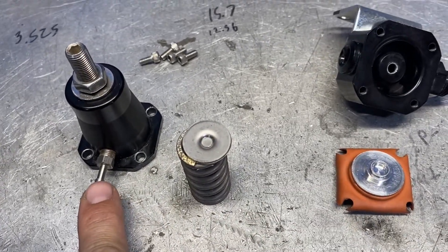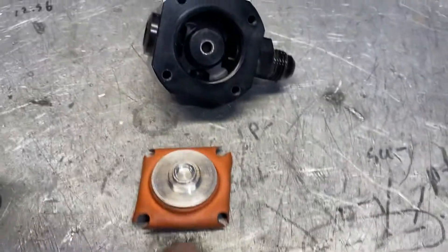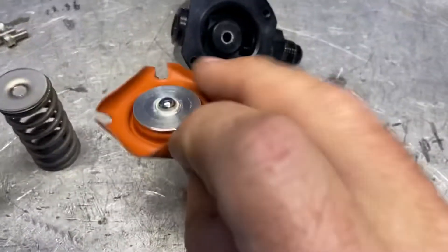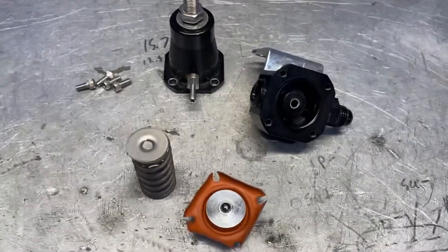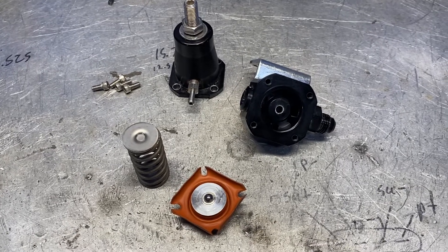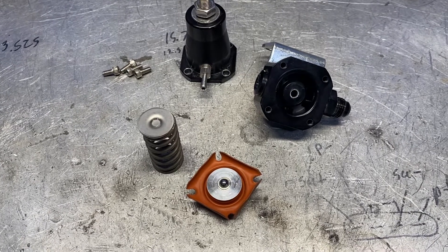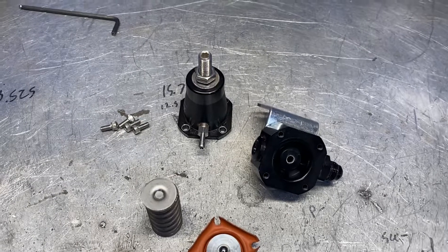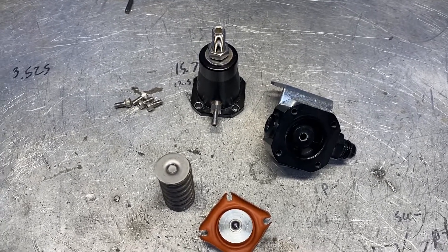That's where this pressure port comes into play. As the car starts to build some boost, you've got air pressure coming in here, filling up the inside of this housing, which is then pushing against the top side of this diaphragm and adding that much more force — on the same side with the spring — to the ball, to block off that hole further, which increases the fuel pressure. That's important on a turbocharged vehicle because you need to raise the fuel pressure. These are one to one: one PSI of fuel pressure increase for every one PSI of boost. The reasoning is you want to maintain that outlet pressure of the injector into the intake manifold. As you're creating back pressure on the outlet of the injector by pressurizing your intake manifold, you need to increase the fuel pressure in order to maintain the same flow rate.